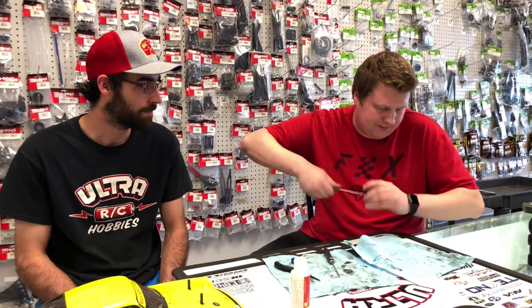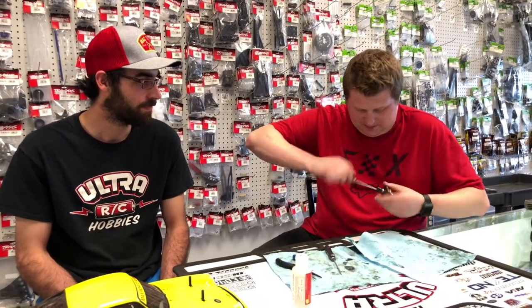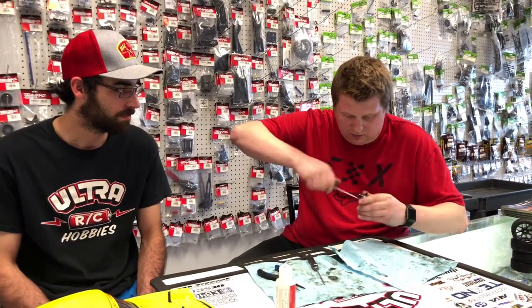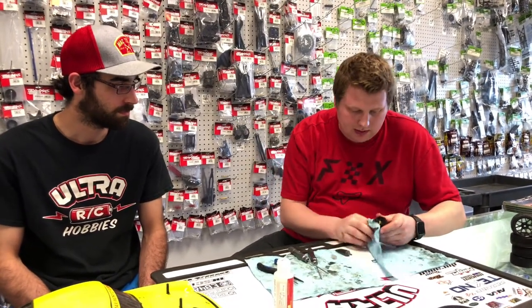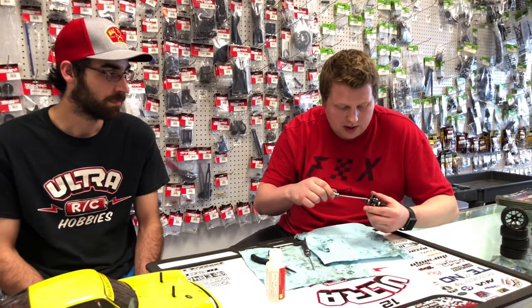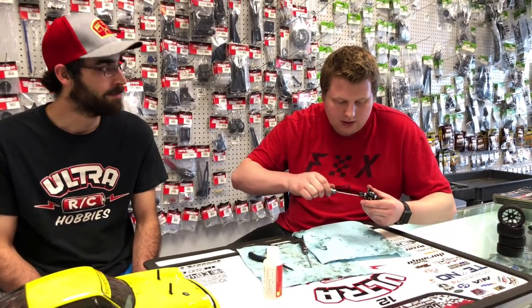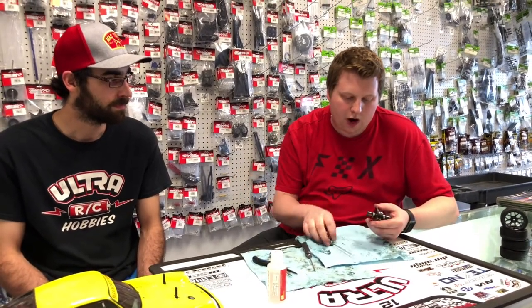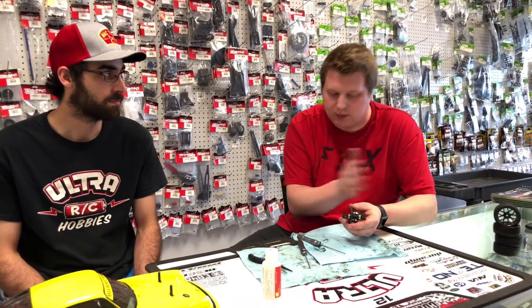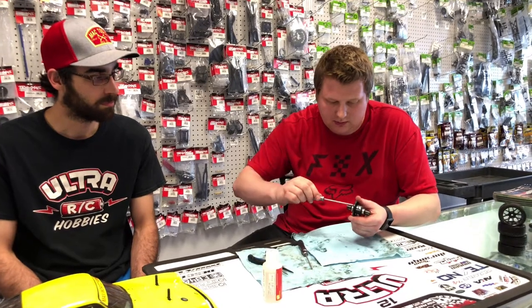Okay, last one. Okay, so like I said, we just have all of them snug now. And now the biggest thing is you always want to make sure you rotate as you tighten. You don't want to really get this ring gear offset. You always want to try and get it as flat as possible on this case.